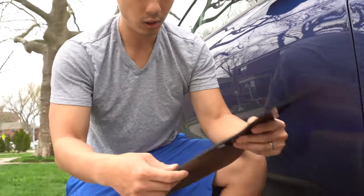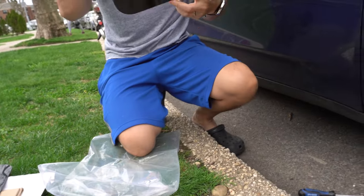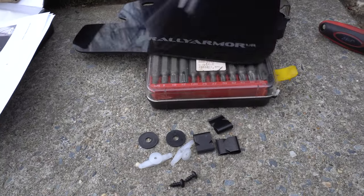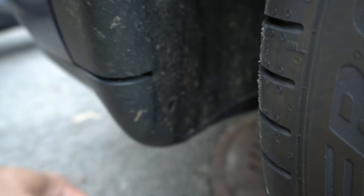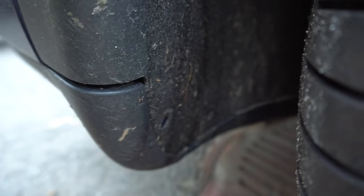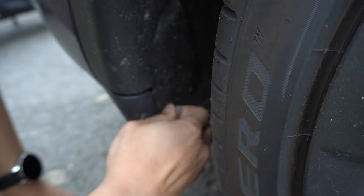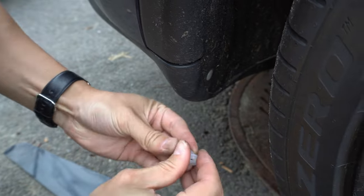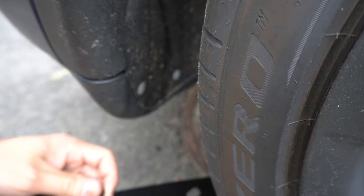The fronts are now installed, so we will install the rear. Come down here and take a look - there's two retaining clips, pop those out. Then we put in the expansion clips: number one, push in, number two, bend - stick one right here, then number two. Then washer and screw - let's do the one on the inside first with the ratcheting screwdriver.